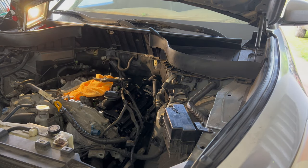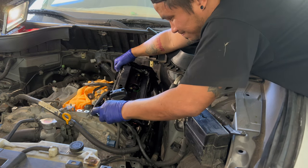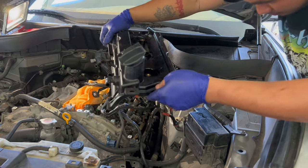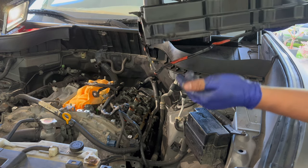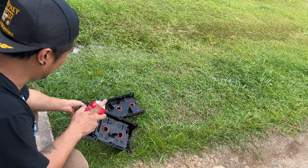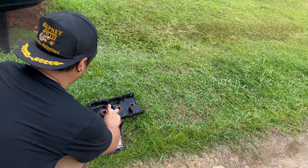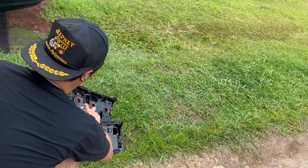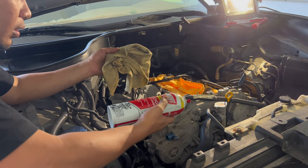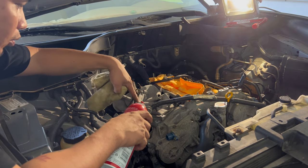When you do put the gaskets in, you don't want to push because it'll go out of place — just keep tapping it. Tap your thumb down on it and make it sink. I put some RTV where I felt it would come loose, at the ends. If there's a gap, the RTV kind of acts as a seal maker and sticks things together — it's strong. We're good. We're going to put it in after we put the other seal on the right-hand valve cover. I don't know if most people do it, but it actually takes one hour to harden. The instructions say when you put that on, leave it for an hour so it gets hard, and then you can put it on and tighten it. We're going to let it bake for a bit, then put it back in.